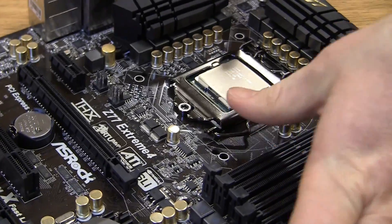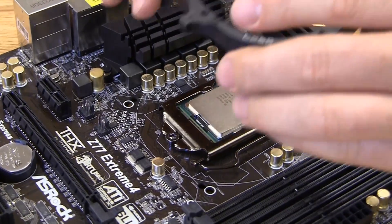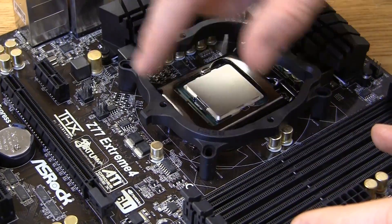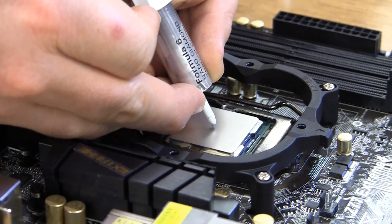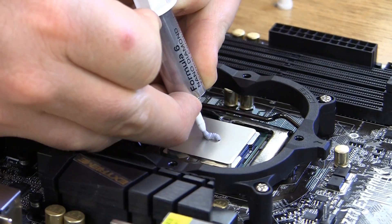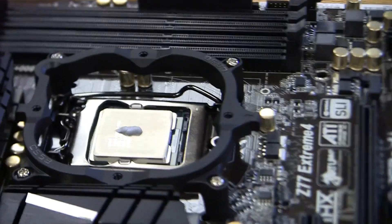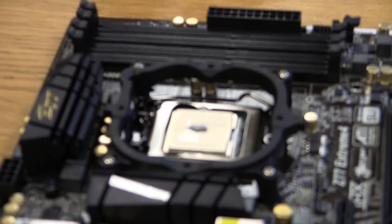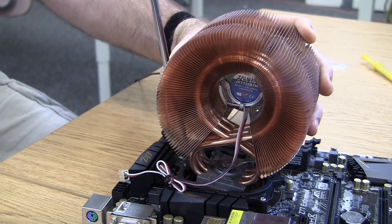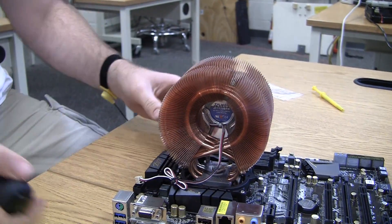Clamp the CPU into the socket of course, and make sure your back plate is in place if you do have a back plate for your cooler. Once it's all clamped down, you're going to put a blob of thermal paste onto the CPU — it should be about the size of half a penny, let's say. Use this video for reference. We're going to use the pressure applied by the cooler to naturally spread the paste around on its own, so apply the compound centrally. Clamp the cooler into place, secure it firmly without over-tightening, and you're done. It should have squished the thermal paste around underneath it — no need to lift it off and check, as that will eliminate the purpose of doing all of this. Just trust that it has spread around as long as you put down enough.